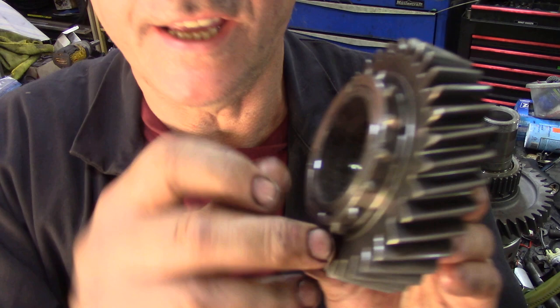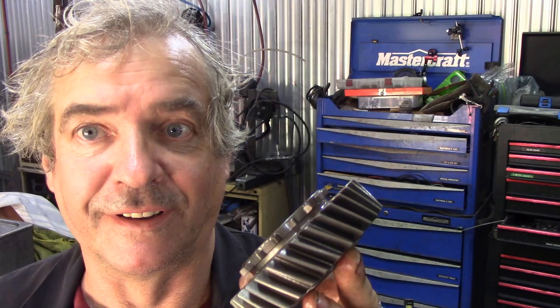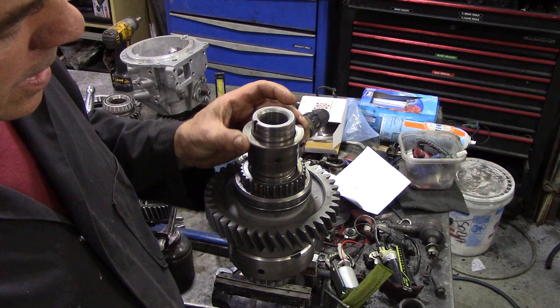It was free here and tight here. I'm going to play safe, take it down to JP and put it on his table because he's got more accurate tools than my fingernails. What we can do — it's a really easy fix — we'll just put it on the surface grinder and take a tiny hair off here, just so it's not tight. You don't want it sloppy, but you certainly don't want it tight like that. Let's go see what he can fix up.